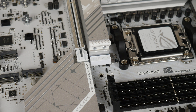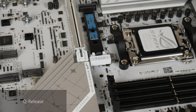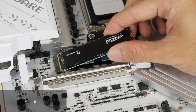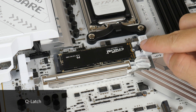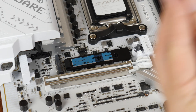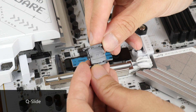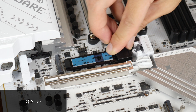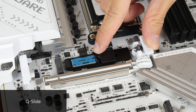That said, the primary PCIe 5.0 x4 M.2 slot comes with a pretty fancy heatsink that features a fabric pull tag, and also features the new Q-Release mechanism — pushing down on the latch here will release the heatsink. The slot also features an improved Q-Latch feature that makes installing and removing an M.2 drive a breeze. Another new quality-of-life feature is called Q-Slide, which is a mechanism that slides along a track, and once you've got the device installed, it snaps into place to securely hold an M.2 drive of varying lengths. Pretty nifty.